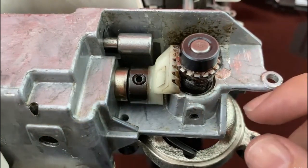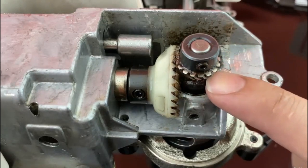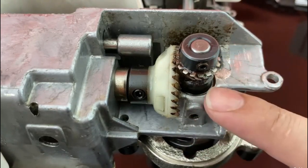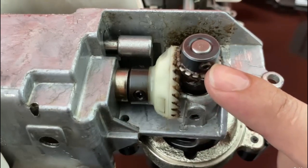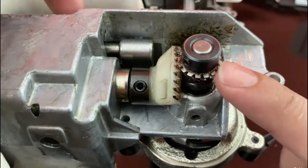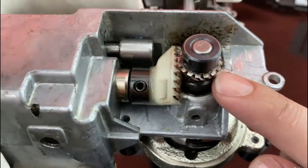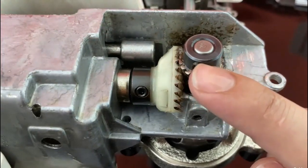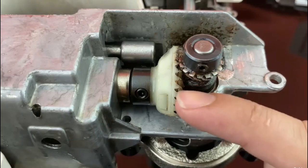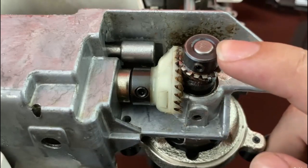And we will note the following. We must always loosen the gear holding the crab shaft. In this case, we see that all this is the crab. Loosen these two screws that hold the axis. This part will stop moving. If it keeps moving, we are simply going to apply force to the front part of the crab to move it. Since loosening the two screws leaves the shaft without pressure, the piece that meshes with it will not move, and you can turn freely.